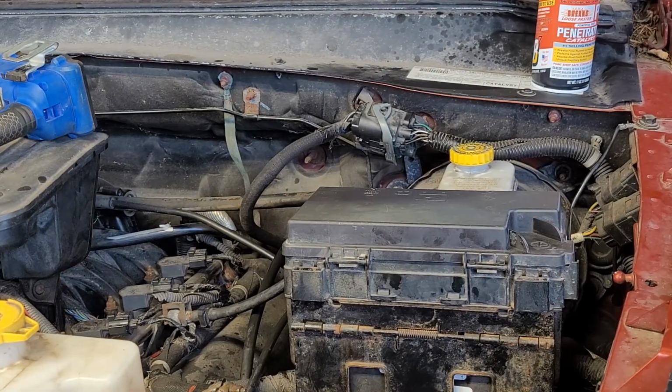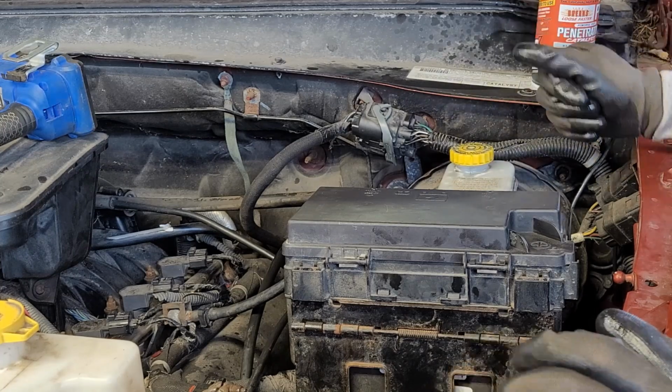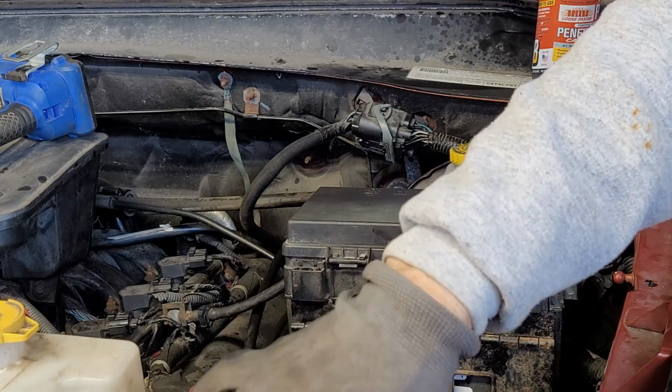And from the master cylinder going to the, I'll put all these B-nuts and flares right back into this master cylinder. It's dirty now too. You don't want to put contaminated fluid back in your system. You want to keep it as clean as possible. It can cost you a little bit of money for brake fluid. You want to use new, even if you pumped it out of here. You really want to go ahead and put new fluid in.